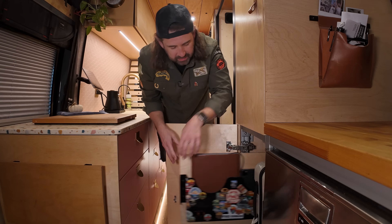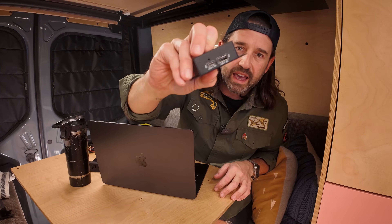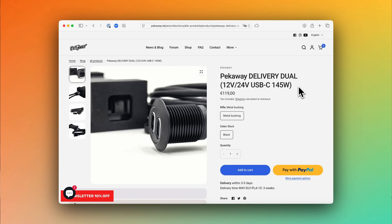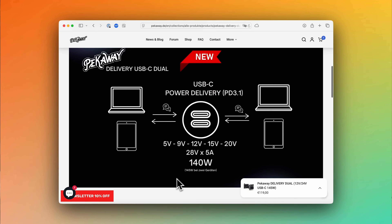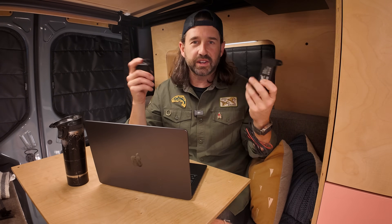In our charging pantry, I use the 110-watt model with two USB-C PD ports for laptops and tablets so we can charge them at high speed when they're not in use. This is where we hang out and do a lot of our work, so we put USB charging on the front of both benches. But I don't really need USB-A anymore, so I'm swapping out this USB-A/USB-C charger. PeekAway have sent me their 145-watt dual USB-C charger. It has a slightly wider voltage input at 9 to 32 volts, making it safe for 24-volt systems. And thanks to Power Delivery 3.1, it can charge up to 140 watts to a single device. I also love that as USB technology evolves, you can swap old ports for new ones without having to touch your AC outlets.